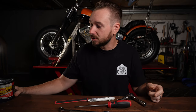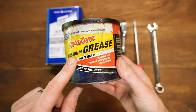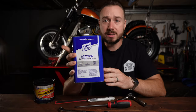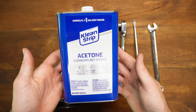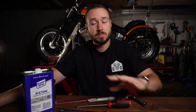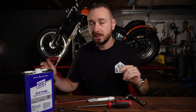That's basically everything you need to do this job. But if your setup has been ridden for a while, it starts to get a little gunked up and sometimes things aren't moving as freely as they need to. So having a little bit of grease on hand — this here is premium grease — just to lubricate the parts and make sure everything's moving the way it's supposed to while you're dialing in the setup. And on that same topic, if anything is super gunked up, you might want some acetone on hand. If you're a TIG welder, you probably already have a ton of this in your garage. Acetone is also good for cleaning your clutch plates. We're not going to pull the clutch plates out today, but any parts that are super grimy need to be cleaned — a little acetone does great.